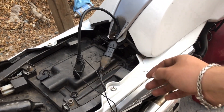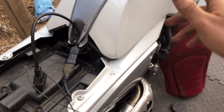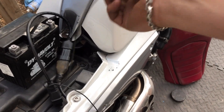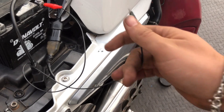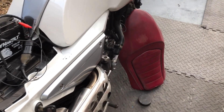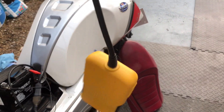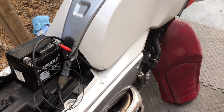This OBD plug needs to be connected here — so that's plugged in. I've got these two wires here. I don't want to remove the fuel tank just to show you guys how to read fault codes. I've got a spare battery here — Blue Peter style — and we're going to attach the positive to the positive plug and the negative to the negative. In a future video I do mention a problem with the OBD scanner. I bought this as a kit, it was about 32 pounds.